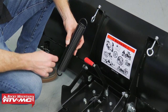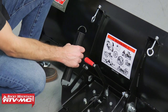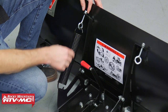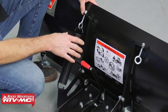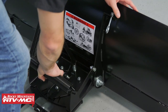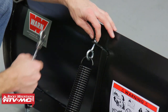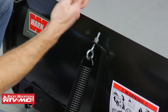The next step is to install your springs. You're going to want to start at the plow base — put that into place, pull this back as far as it goes, and stretch the spring into the eyelet. The spring will be loose for now. Once you have the second spring installed, tighten these bolts until there's tension on the spring. Just the right tension is where this spring cannot come off easily. Once you have the desired tension, tighten down this jam nut and make sure they can't come undone on their own.